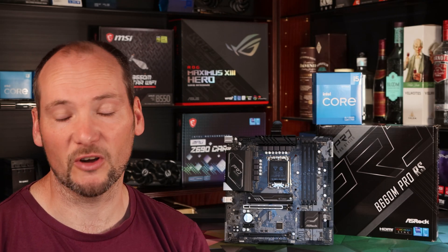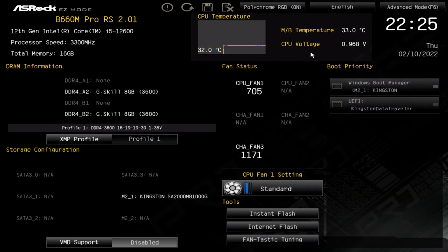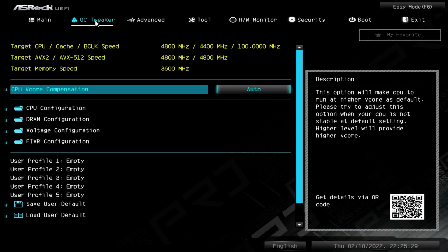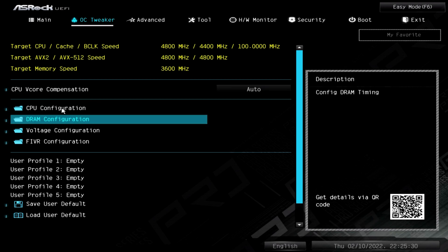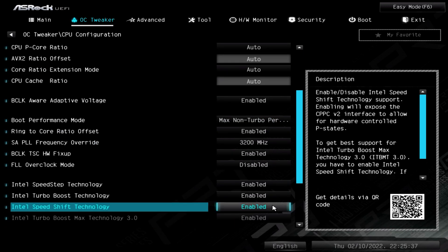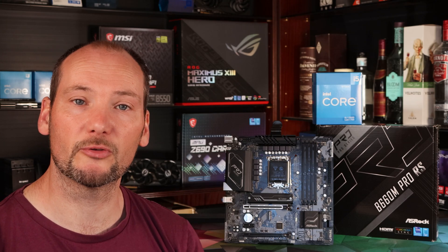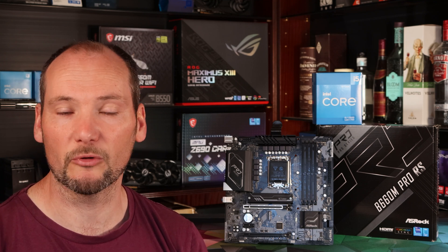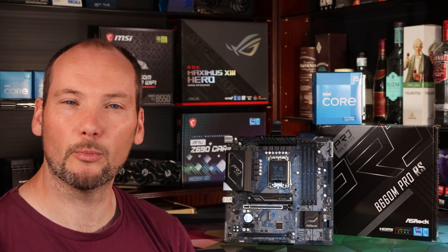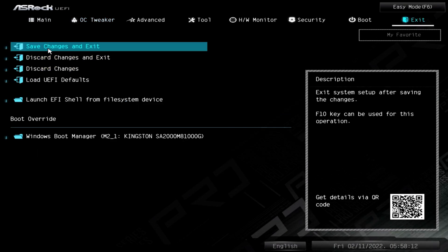Talking about the BIOS, ASRock's BIOS is functional but somewhat rudimentary in appearance, though they do have a good number of options and it's pretty well laid out. There are easy and advanced modes and you shouldn't need to do much beyond enabling XMP since there's no official CPU overclocking support. This board doesn't allow b-clock overclocking of non-K CPUs beyond a few megahertz as it lacks a separate b-clock generator. Overall it's a perfectly good BIOS and we had no problems setting up the PC and installing Windows on multiple occasions. However the major problem with this motherboard did see us spend a significantly longer time in BIOS than we'd ideally like.